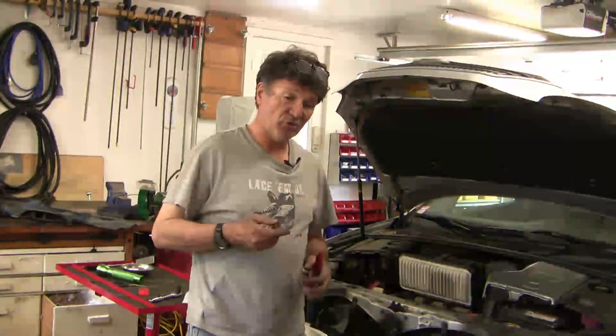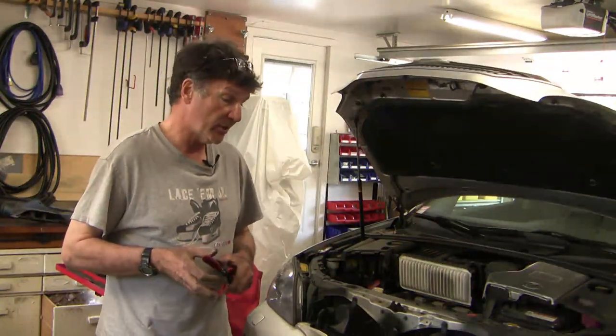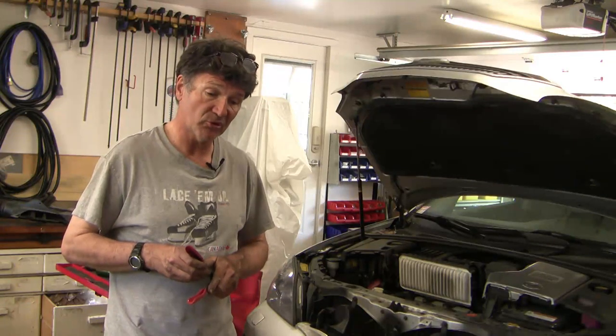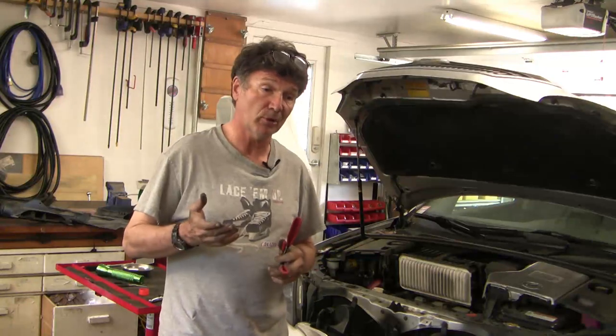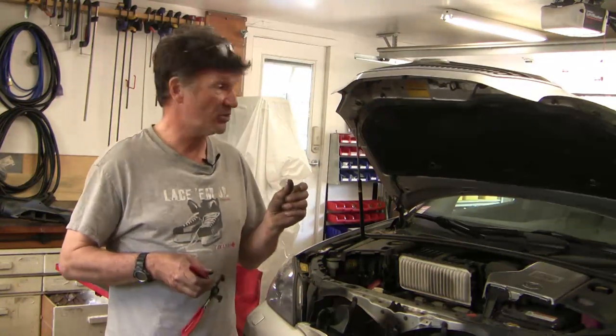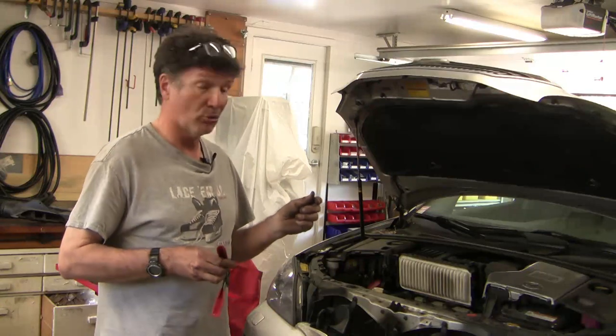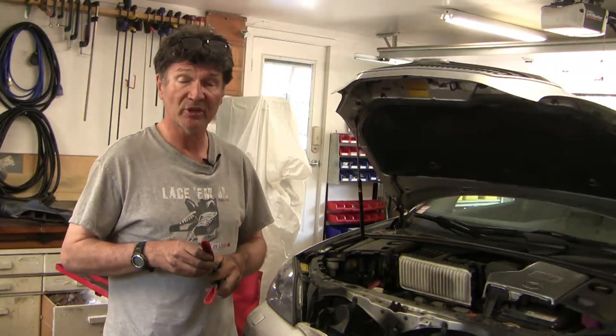While you're doing this procedure, you're supposed to have a look at the radiator cap, the thermostat, all the hoses and hose clamps, and replace anything that's doubtful. In my case, I never had any issues with overheating, and I don't see a reason to replace the thermostat. The cap looks fine, all the hoses look good, and the only hose clamp that's in a tight spot is the one on the bottom, which is hard to get an OEM-style clamp on, so I just switched to a conventional clamp.